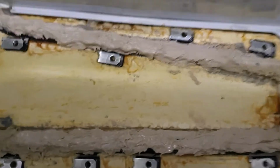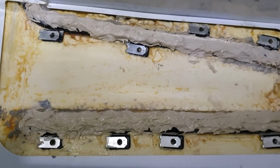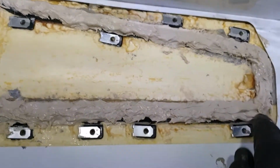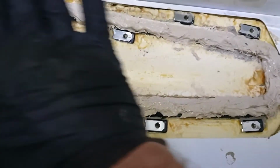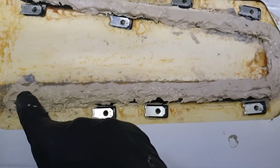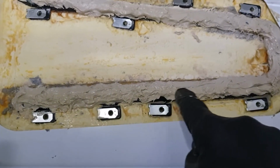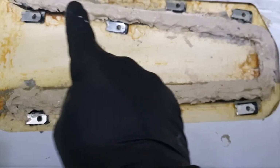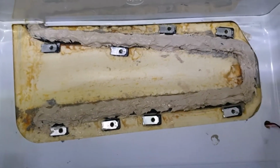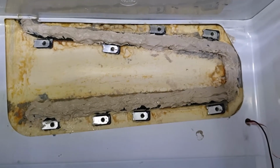It's all on. So normally, with a heatsink compound where you've got two flat surfaces, less is better. But given this is a round surface meeting a flat surface, I've gone for more, so that as I put the heatsink on, it will flatten that, give us a greater contact area, and hopefully transfer, you know, better from the curved sections either side of this very small center point of the hose that makes contact with the heatsink. So I'll stick the heatsink on. Well, I call it a heatsink. I suppose it is the finned arrangement, and then I'll pull it off and see what it looks like, I think.